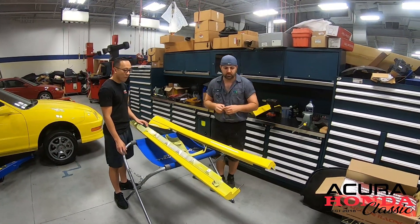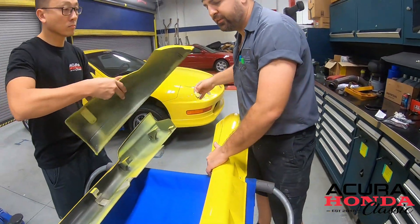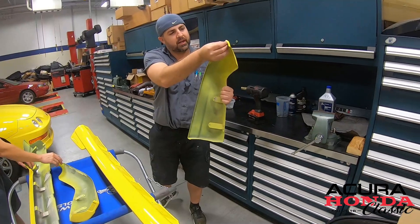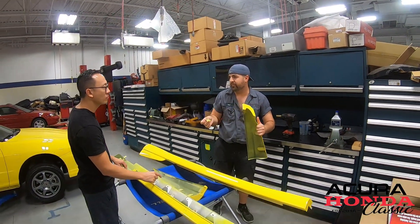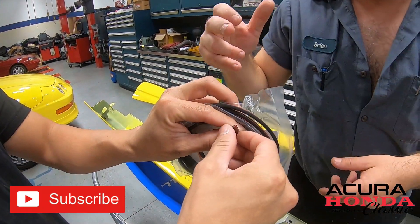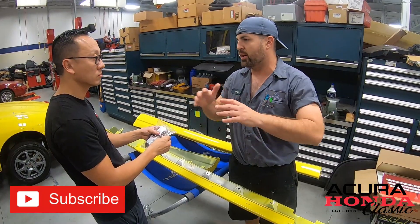It's an applicator pad and it's kind of wet. All you do is put it in the area — for instance, this is where the rubber would go — you just go along the back. I'm going to take this one and go along the back. It gets just a little bit of adhesion. That's all it is. So what does that do? Pretty much this makes the double-sided tape stick. When these two come together, you can't get them apart. There's a chemical reaction between the tape and the adhesion promoter — they bond together. So when you go to put it on, you don't have to worry about it wiggling around. That's true for any automotive body part that uses double-sided tape.